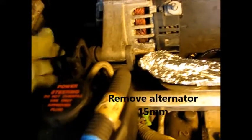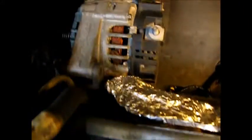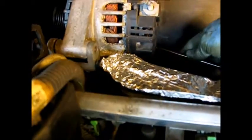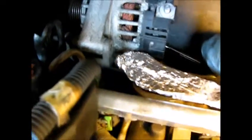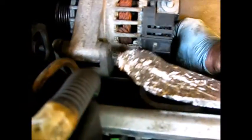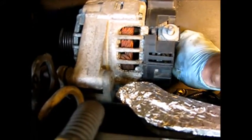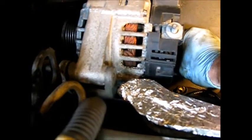So with our front bolt separated now from the upper manifold, we can loosen our rear bolts. About the only thing you can get on here — at least on the far back one, you might be able to get a socket on there — but I'm just using a 15 millimeter box end. In the back you're going to have to get back in here with both hands and turn that longer one out. That's on the left side as we're looking at it.